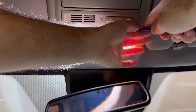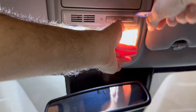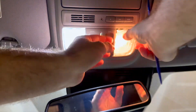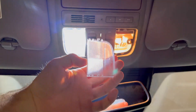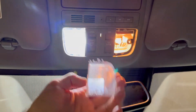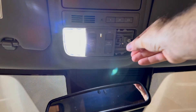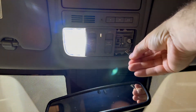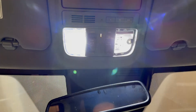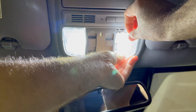Let's go ahead and get the other one out — just pull down and be careful not to break those clips. No clips were harmed in the process of this video. Again make sure you grab something to protect your hand, then stick the light in so it illuminates that way. Let me flip it around — you can put those bulbs in either way, there's no polarity. I'm going to put this clip back in and we're all done there.